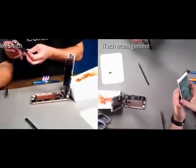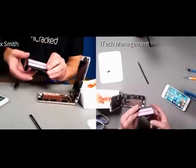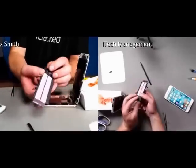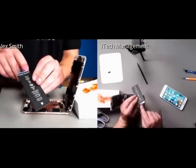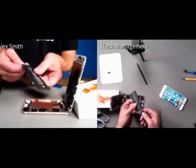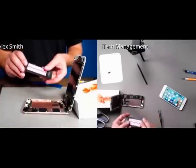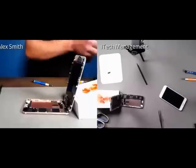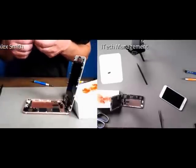The black wraps around, right? Yeah. Like that? Yep. So if you're doing a battery replacement, you see that I put 2 new adhesive strips on, and there's actually 2 little black tabs right there that are going to wrap around so that the next person, if we're doing another battery replacement, can easily peel this off, but it's holding the battery in place, which is great that Ed happened to have these 10 feet away.